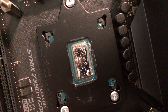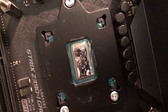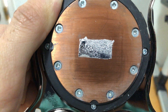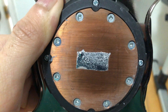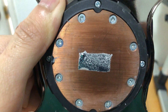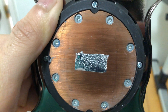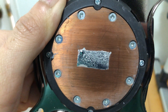At the bottom left of the CPU die there's a part that looks like the liquid metal was dried out. We will come back to that when I clean the CPU. The same stained area can be found on my water block — no liquid here. My guess is there was a chemical reaction at that area and I just had enough or too little TIM, so it dried out compared to the other parts.